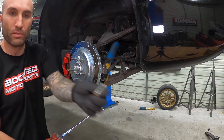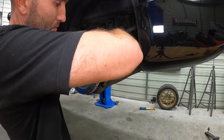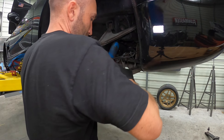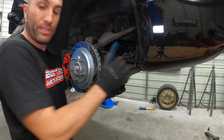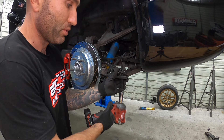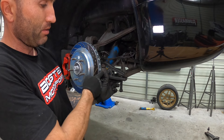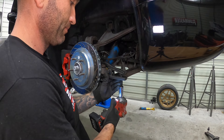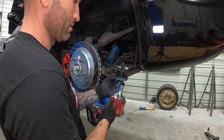Let's feed this in here and get it into the hole at the top of the frame. We've got our shock coming into place — we're just holding it for now. Let's go ahead and put the hardware on top, which will actually hold and hang the shock. Take our Delrin coned washer with the flat side down, then the aluminum cup washer, then spin the nut on there just to hold everything in place. We've got the hardware on top and then installed our two bolts on the bottom with the associated nuts.